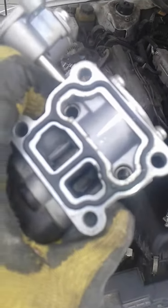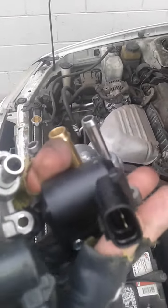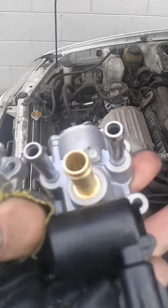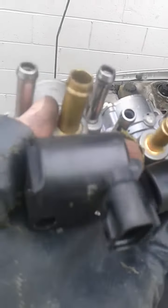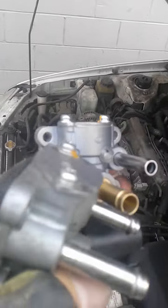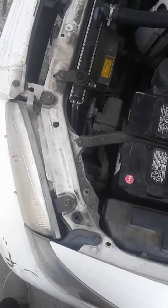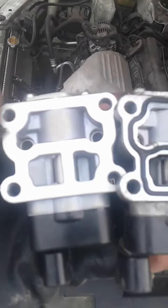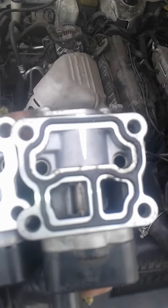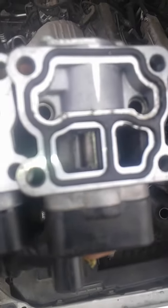Even after cleaning, when I stopped at stoplights the engine would still cut out, because dirt got in there and this valve wouldn't open. So I decided to just buy a new one, which was about a hundred and sixty-seven dollars. I'm gonna put it in but keep the old one as backup in case this one doesn't work. The old one has this rubber gasket and the new one doesn't, which worries me. You can see the valve in the new one is clean, and the valve in the old one is dirty.